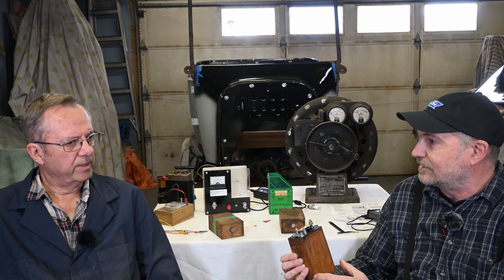Before doing sophisticated tests, it's important to first talk about the fundamental tests you can do on a coil box with a multimeter. I'll link the Ron Patterson sheet in the description below — you can download it. It tells you what tests to run: the resistance of the different windings, the capacitance of the condenser, how to set your point gaps, and so on. Before you do any sophisticated tests, make sure your coils are sound from the perspective of these fundamental multimeter tests.